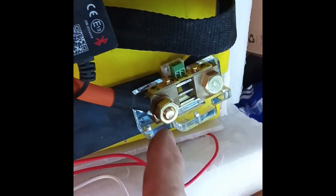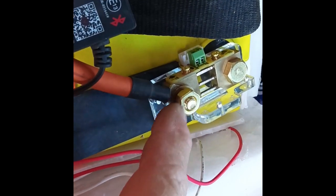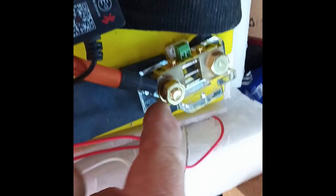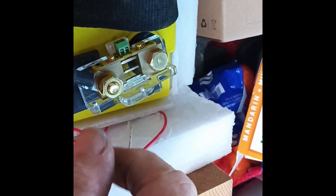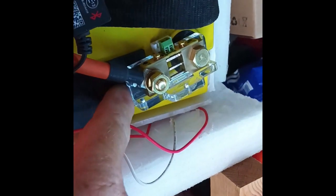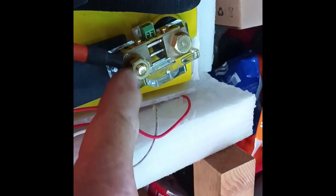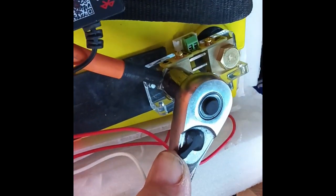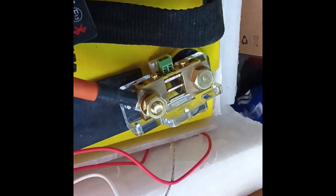One thing to watch out for, because there's a gap underneath here now, when you go to put this on, the lug will have fallen down a bit. So I have a little shim in here that kept it up in that little recessed area that holds the bolt while you're tightening. And again, because that's plastic down there holding that bolt, you don't want to over tighten this because it could crack that. So I don't know what foot-pounds or anything are on there, but anyway, that's what I've done, not too much.